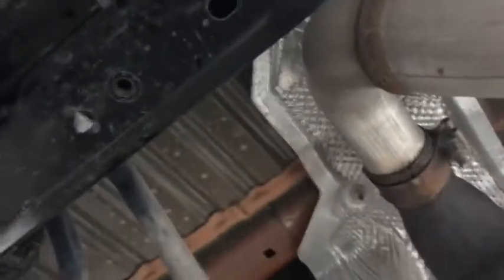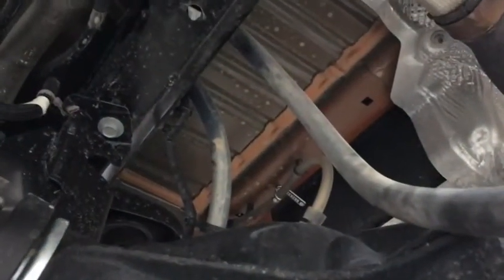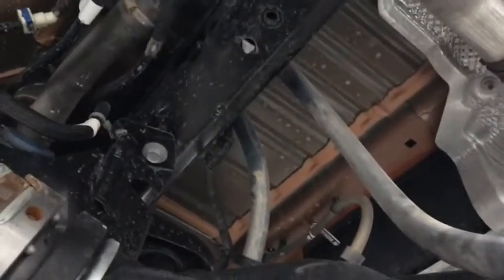So I'm curious how that's gonna work over here. But I'll figure it out. But just so you know, that's what they want you to do before you even drop the axle. Because once you do that, you're gonna stretch these out and destroy the lines. You don't want to do that. All right. Take it easy.